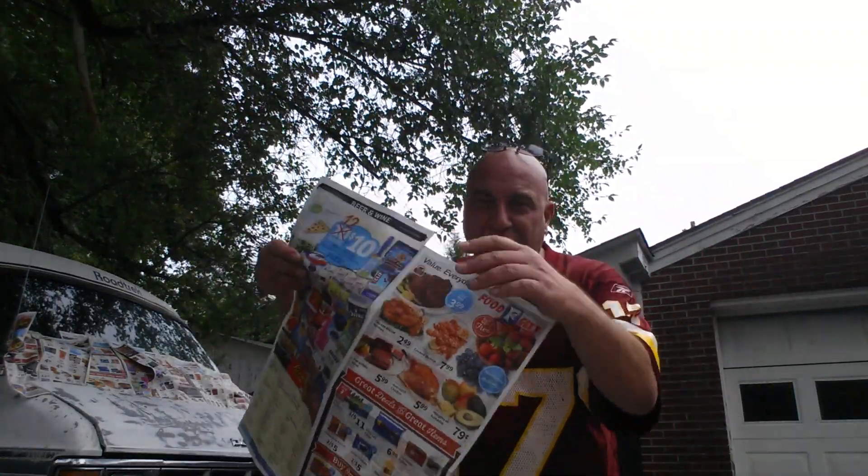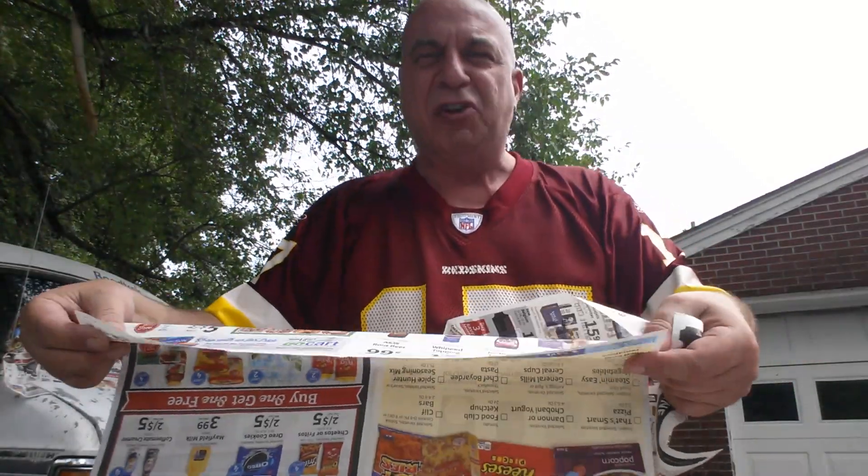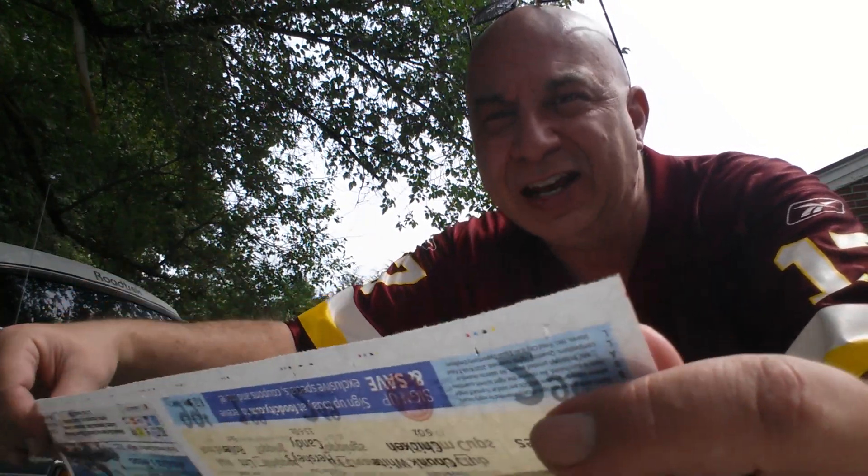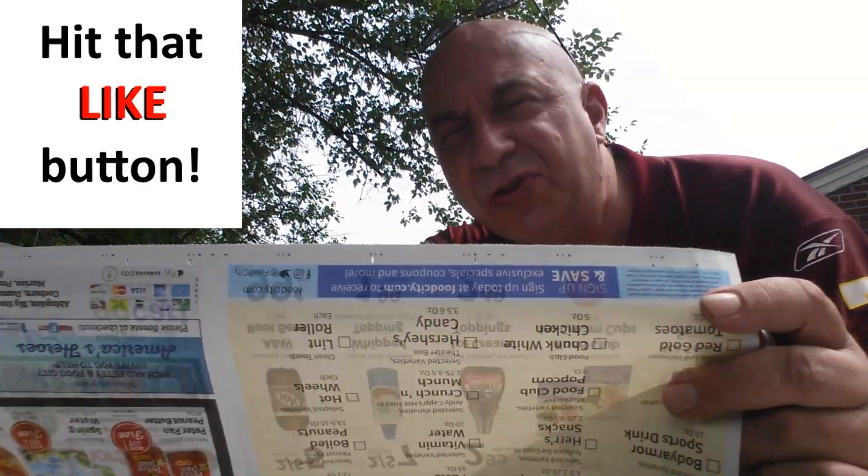Some quick tips on taping this stuff off when you're going to paint it, because we are doing this the quick and dirty way. You don't have access to a lot of newspapers? Most newspaper offices will sell you a bundle of old papers for just a couple of bucks. These were sale papers — you can get full-size newspapers, tear them sheets in half, whatever you need. But what you need to know is there's going to be one side that has these little perforations, pinholes — that's where the rollers and machinery grab stuff and pull it through. So you want to tape that edge to the vehicle so those little holes are covered and you don't have paint going where you don't want it to go.